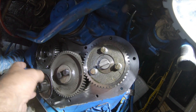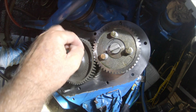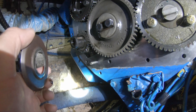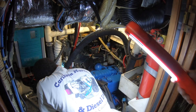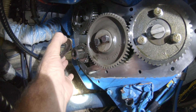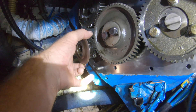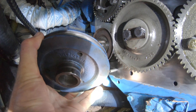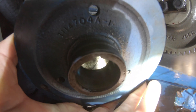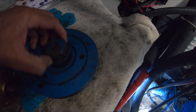I've put a bit of oil on these gears just to stop them binding up. Oil should start flowing through here once the engine is started, but I want to make sure there's plenty of oil on them. This plate here is keyed — I wasn't sure what it was at first, but I worked out it has to go in here because it can't go anywhere else. This is our main pulley shaft; it's got a key in it. You can see that key slides over the top once the timing case goes on.